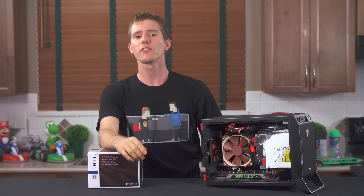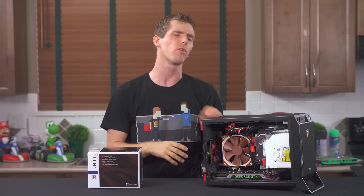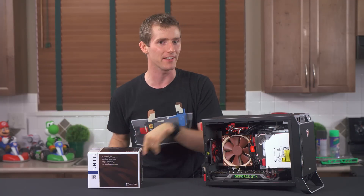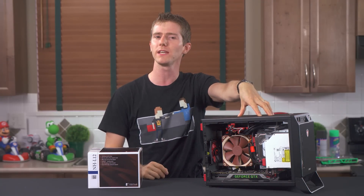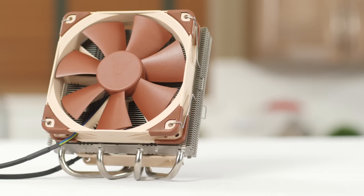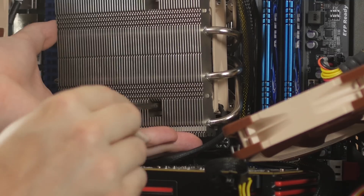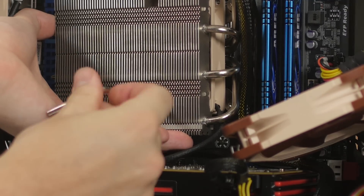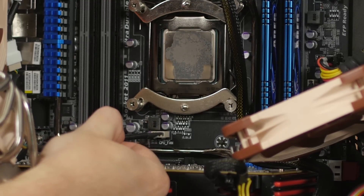The performance and mounting rundown on the NH-L12 in both our standard test bench and the MSI Nightblade Small Form Factor Bare Bones PC where we originally showed it to you. Installation of the NH-L12 was incredibly easy, and I was kind of surprised you don't actually have to worry about that bottom fan — you can just leave it installed, because all you have to do is feed your screwdriver through the little hole on the heat fins on the top and it goes in between the fins of the fan down below and lets you screw in.